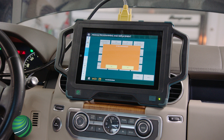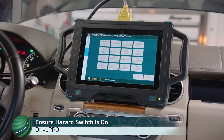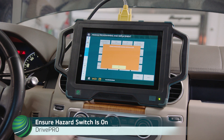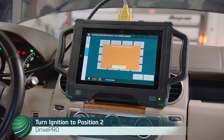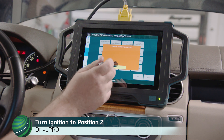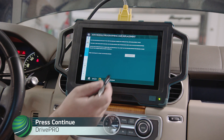For Fitted Modules, select Yes. For Modules that have not been fitted, select No. Fitted refers to Installed. In this example, we will select Yes. Please make sure the hazard switch is on — this keeps the body control module awake during the procedure. Select OK. Turn the ignition to Position 2 and select OK. Press Continue to Start KVM Programming.